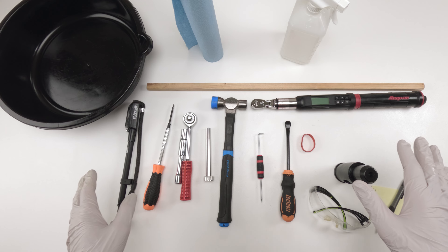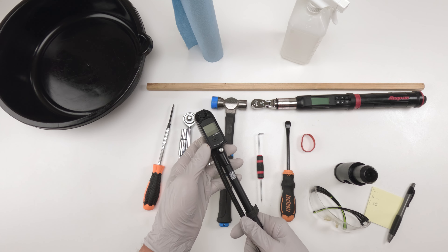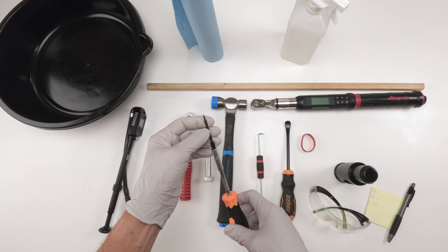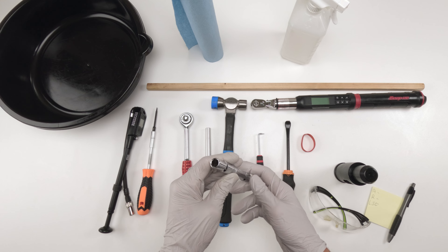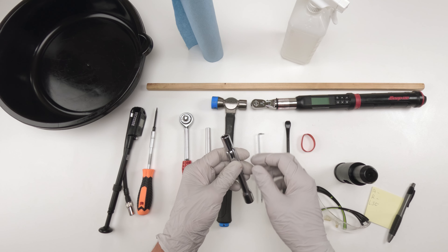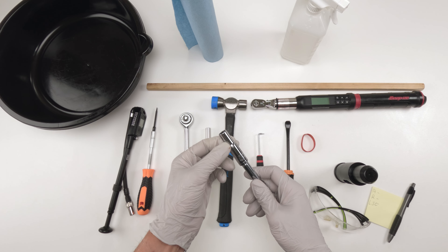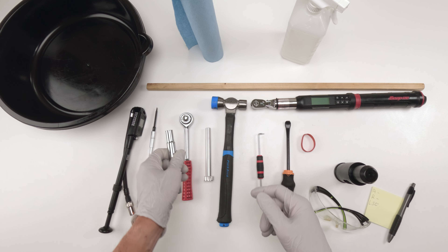In order of use, the first thing we're going to do is write down our existing settings. We're going to use an air pump to grab our current PSI and then slowly take out the air from the air spring side. Then we're going to take out the rebound knob at the bottom — we need a two millimeter Allen to do that. Now this is a Stepcast 34, and both nuts at the bottom are 10 millimeters. We're going to need a 10 millimeter socket — a long depth socket, narrow socket — very important. A thick socket won't fit on the air side or the damper side.